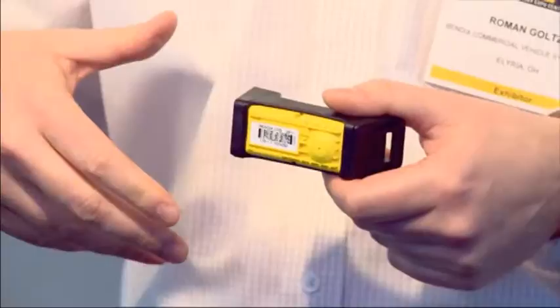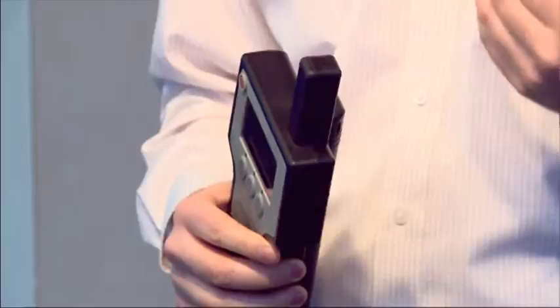Coming back to these sensors — they actually operate with a battery internally that's good for five years. The sensor operates all the time, so whether the vehicle is shut down or not, it will keep measuring your pressure and temperature in the tires. When the driver first keys on the truck, within the first five minutes you will get a full complement of all your pressures and temperatures throughout the vehicle. That takes away the need for going around and manually checking the tires. Because they're mounted inside the tire, you don't have to take the valve cap off. You could simply use one of our hand tools and ping the sensor right through the sidewall of the tire and get a pressure and temperature reading directly on the hand tool if you didn't use the gauge mounted in the cab. So you have two ways of diagnosing.